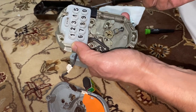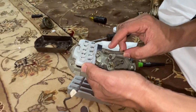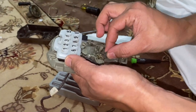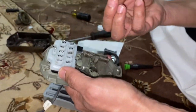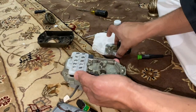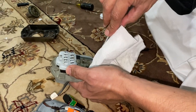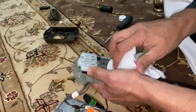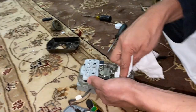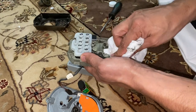You really have to take it apart and clean it. Even the springs — make sure you check the spring and make sure you have enough spring tension on there. I'm going to remove it and all those small parts at the bottom, clean them really good, and put everything back. Once everything is clean, you may want to use some kind of lubrication. Just get a napkin, wipe it, put a screwdriver in there with a napkin and give it a nice clean. You may have a bunch of black goo — over the years it piles up. It's pretty common for these locks to collect dust and stuff like that inside.